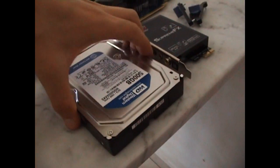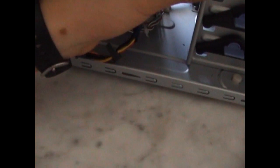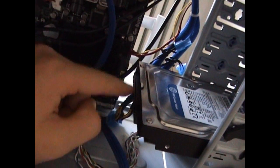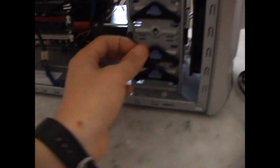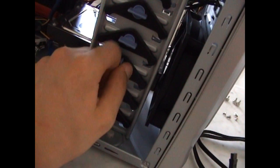Next, let's mount the hard disk drive. Choose a bay that is more convenient for you and slide the drive all the way in, letting the SATA connectors stay exposed to attach power and data — the same has to be done with the optical disk drive. If you don't do so, obviously you can't connect the data and power cables.